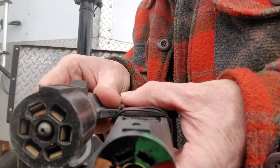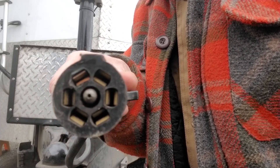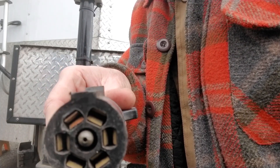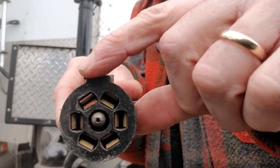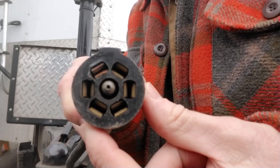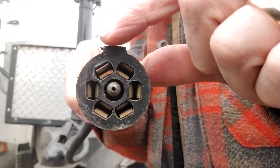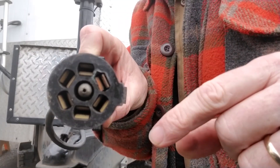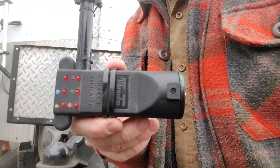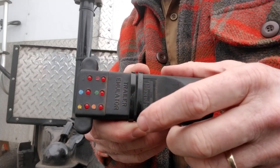Now on these seven-way connectors — this is seven-way — this is what you're going to connect your RV into your tow vehicle with. So let's define some things. I'm going to call this the little key, and the rest of this is just circular. There are six pins plus the seventh in the middle. Everything I'm going to talk about, I'm going to reference with this key at the top. This is one of these testers — you pick them up at the parts store, you plug it into your seven-way and it lights up and tells you if your blinkers are on and all this kind of stuff.